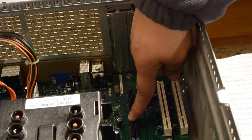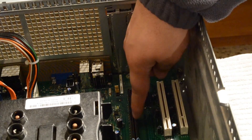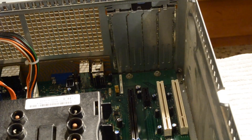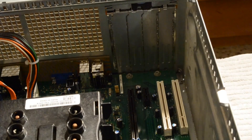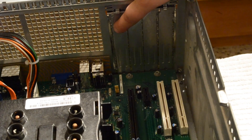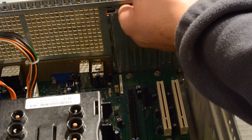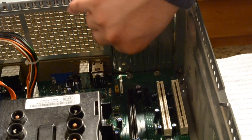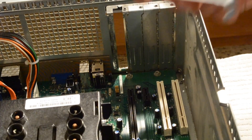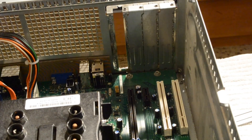In this case, it's right here. The PCI Express slot has a little release right here, and we'll have a couple of different grooves in it, which will correspond with this groove right here on our graphics card. We'll first need to remove this plate right here, which can either be held in with a screw, or in this case, a latching system. I'll simply press right here to release our latching system, then this plate will slide right out. I always recommend hanging on to these in case you ever want to take your graphics card out and you don't want to have a hole in your computer.